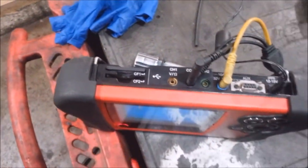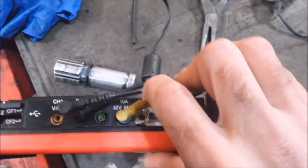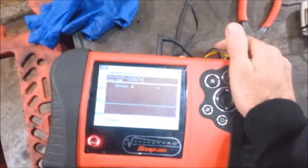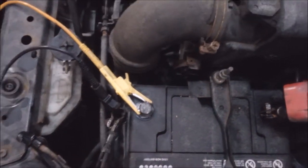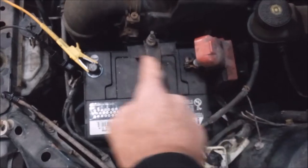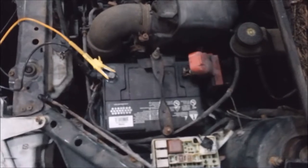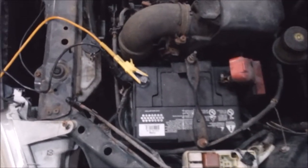It should be okay for a lot of fancy cars. What you do is you just hook it up to an amp scale — 10 amp, common ground — and disconnect the battery terminal and go from negative to negative. When you wire it up for amps, don't ever go positive to negative, because if you do you're going to blow a fuse in your voltmeter and you might burn it out. That's a big no-no on the amp scale.